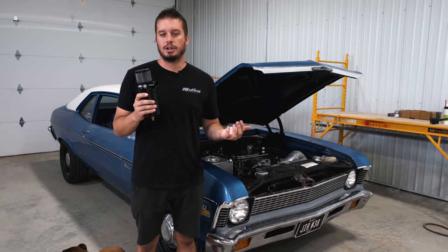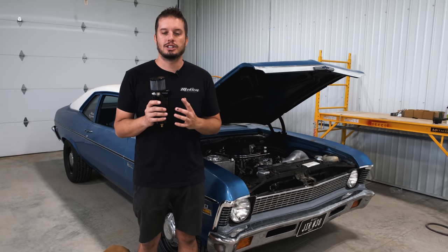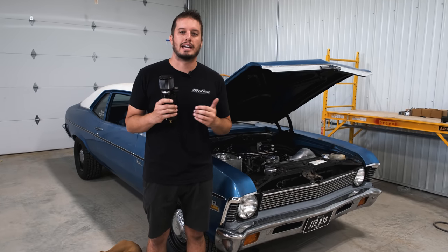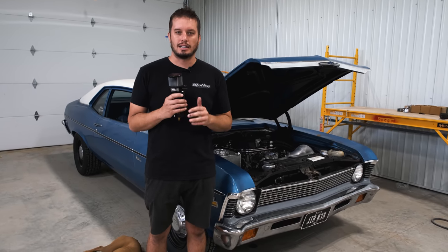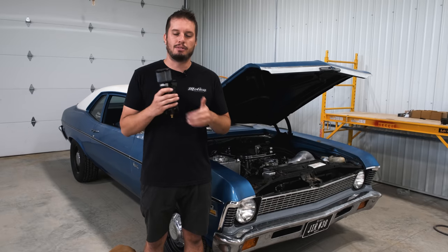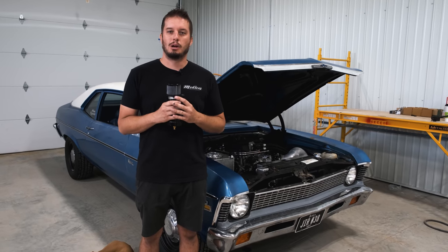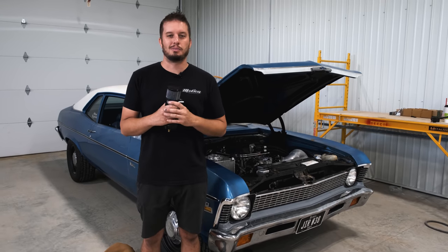In summary, keep it simple. All we want to do is run a line from each valve cover into a catch can. If you have questions about how much catch can or how much ventilation your engine combo needs, give us a call — we're happy to give you direction. Every combo might need a little bit more. For instance, a 2,000 horsepower ethanol boosted application might need two 12AN single catch cans. Most gasoline engines need much less — you can get away with one catch can on 1,500 horsepower and below combos. Every combo is a little different and we deal with this stuff every day. You can also shoot us an email at sales@motionraceworks.com. Hope this video helped — drop ideas for the next Tech Tip Tuesday in the comments below. We'll see you later.